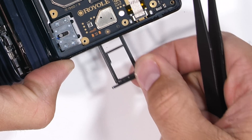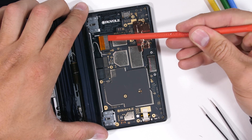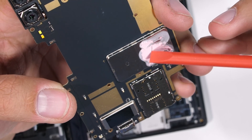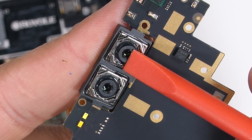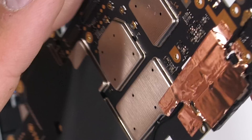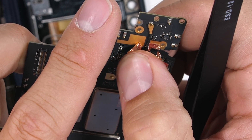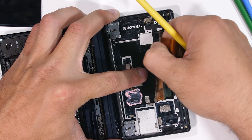I'll remove the SIM and SD card tray before trying to remove the motherboard. There are two more screws holding the motherboard into the metal frame. The screen and battery extension ribbons unsnap like little Legos with my plastic pry tool — I do sell these plastic tools on Amazon if you've ever wanted one. There is some thermal paste on the back of the motherboard but no heat pipes. There is also no optical image stabilization on either of the two rear cameras. Royole does claim OIS on their website, but there is zero movement in the cameras themselves — so I assume they mean EIS, electronic image stabilization, and something was lost in translation. Physical movement of the camera lens is a prerequisite of optical image stabilization. This massive gold ribbon tucked under the motherboard is for the flexible display.